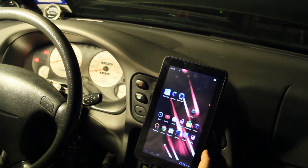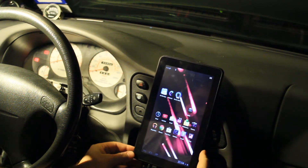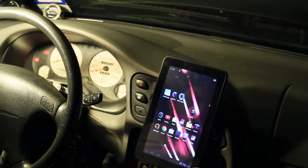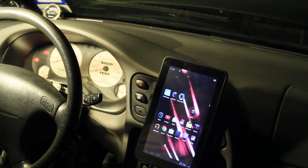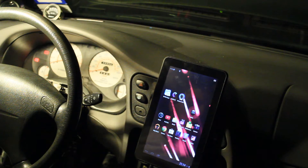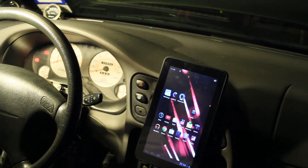I've read on Android forums that some tablets will not support charging while USB OTG is connected. So if you want to hook a flash drive up, you can't charge the tablet at the same time. It's a software feature they have to enable or disable. I think you can root your Nexus 7 or similar tablets to software-fix that limitation, though it seemed kind of strange.